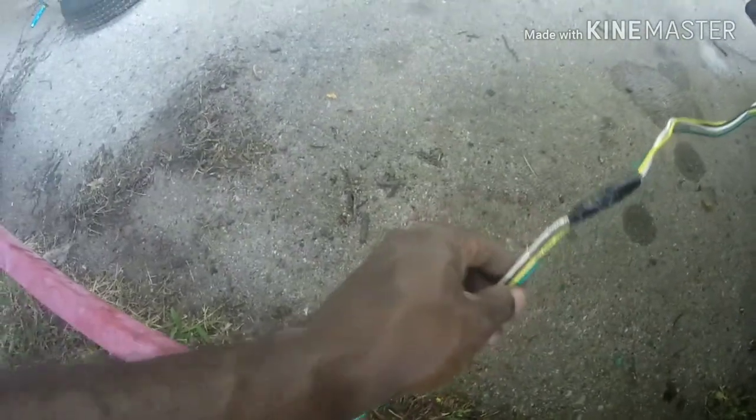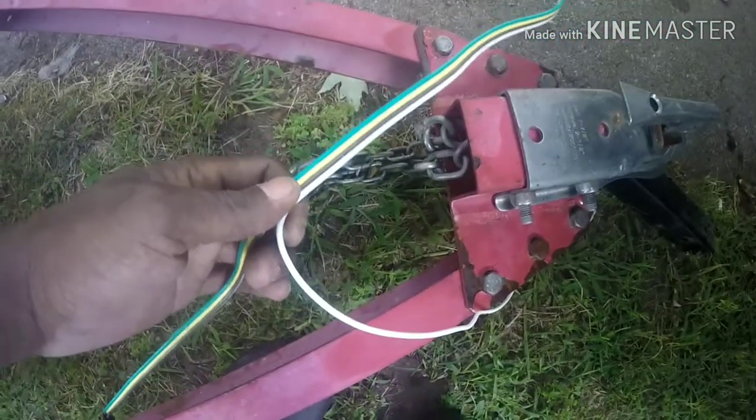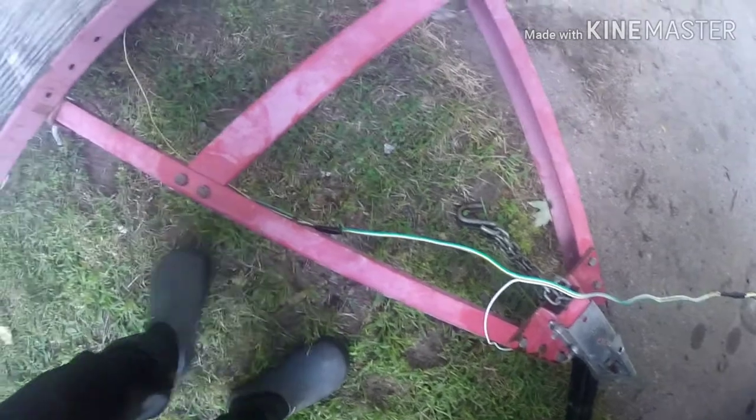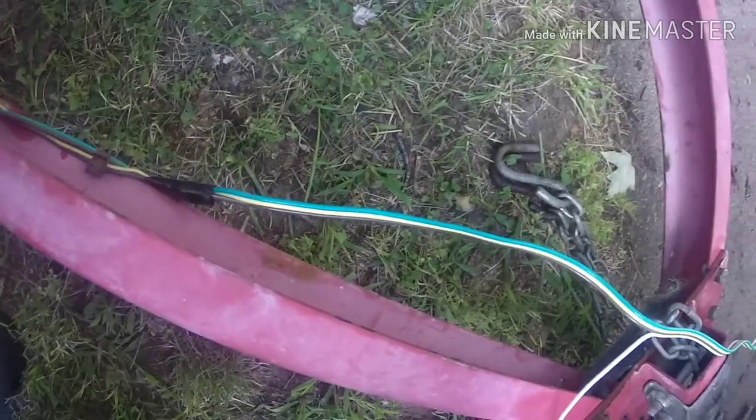The connector coming from the old one was a four-wire, but this new one has five wires. What I did is I had to run two brown wires — actually, it's four wires here, but I had to run three wires into one. This little connector here is just for the tail light. The two browns are the tail lights, the yellow is the left turn signal, the green is the right turn signal, and the white is ground. I grounded it off to the old trailer frame right there. I'm going to show you guys how I got this thing wired up with some nice bright LED lights.